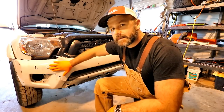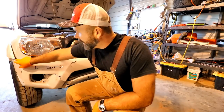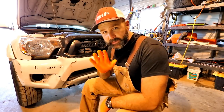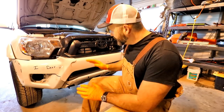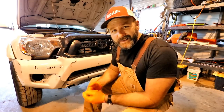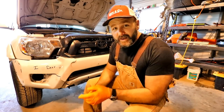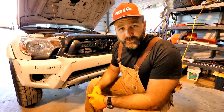Here's what we're working with - my wife hit a deer right here on this side. It dented the fender in just a little bit and popped the little trim piece off, so we got two new tabs for that. The bumper basically - I pulled the bumper off and it pushed the radiator support into the air conditioner condenser. The first thing I did was order a new air conditioner condenser and I put that in after I pulled the radiator support out. I used some manual manipulation to pull that out, but we've got a special tool now to help get it out a little bit further.